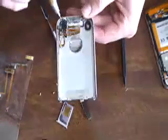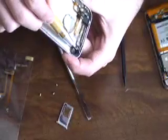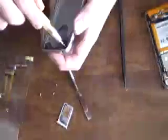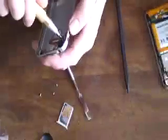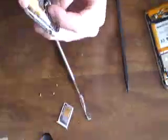You need to be careful with the iPhone power button because it's put in there kind of oddly. Take it out first and make note of how it's connected because you'll have to put it back in again. I think there are about six or so screws — just keep taking the ones out that you see and moving parts around to find the others. You do have to take the vibration module out first, and there's another screw underneath there.